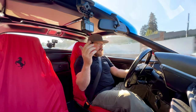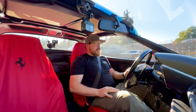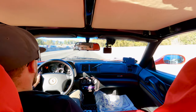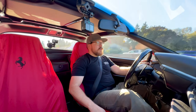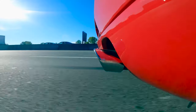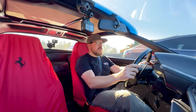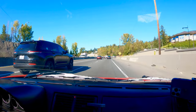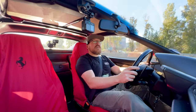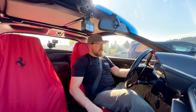Again, we're evaluating our steering wheel. We do have a bit of a vibration in the front, so that would be a bit of a tire balance. Make note of that. I would say the steering wheel is just a hair off to the right. That is a minor thing. Try some different vent positions here. Okay, it's in the fifth gear, smooth and fine. Okay, sixth gear, it's good. So overall, drives very nice. I'm not noticing any squeaks or rattles or noises. AC, I'm actually getting a little cold now, so that's working very good.